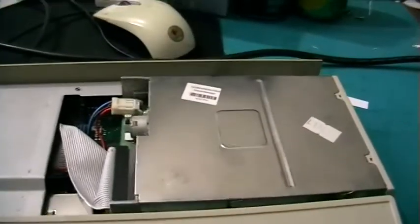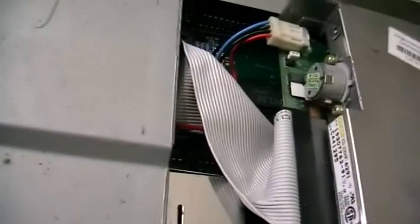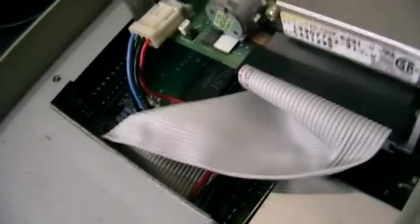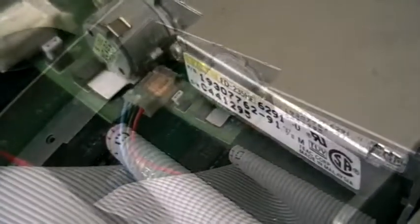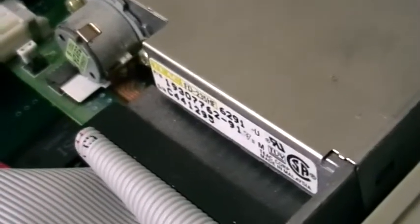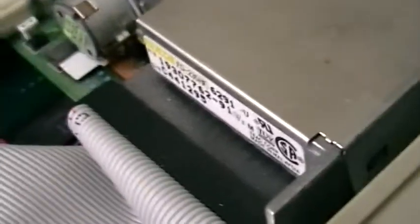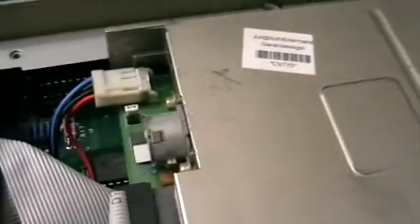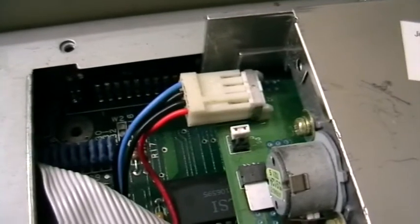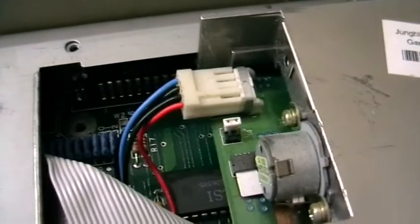Until now I've replaced the floppy with a PC drive. Let's see if it can read — and if I can read it. It's a Teac FD235HF6291U. It's an ordinary PC drive but it has two jumpers, and I had to change these from DS1 to DS0.